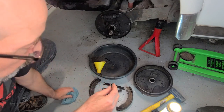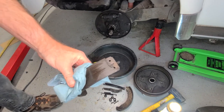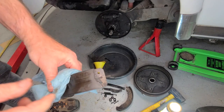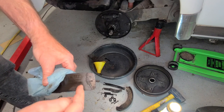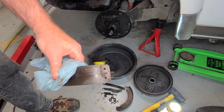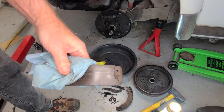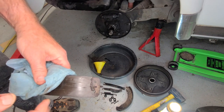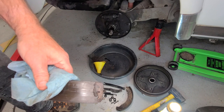Here is the offending item - the brake shoe has fallen off on the backside. Those pieces got caught around inside the drum, then went in between the shoe and the drum, and shimmed themselves in there. That's how the brakes got stuck applied. There was no way this car was going to move. I got it to a point where I could lift it by rocking it back and forth - gravity is your friend in that case.